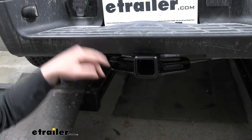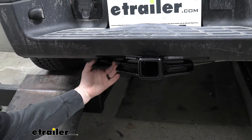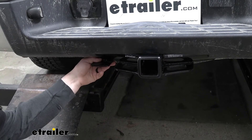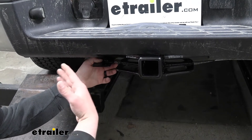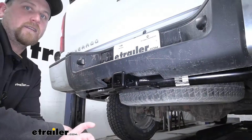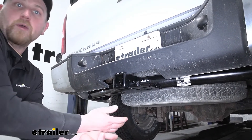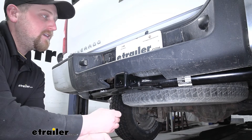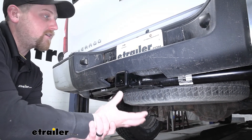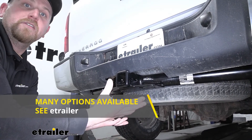It's going to work real good for that. And it's even going to have a pre-attached bracket here, which is convenient if you need to hook up some different type of wiring or wiring in general — if your truck doesn't have it, it gives you a good spot to put it. Now since these Silverados are really versatile and they are built to handle quite a bit of weight, if you do plan on doing some really heavy-duty towing, I would recommend picking up a Class 5 hitch that's built for it too.